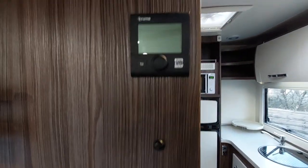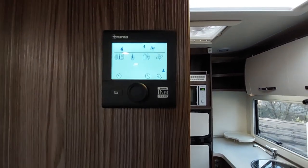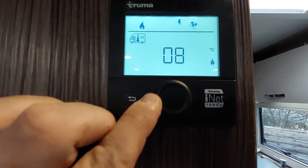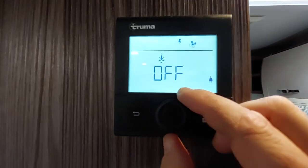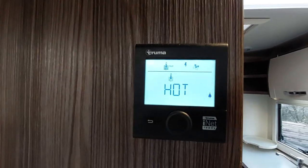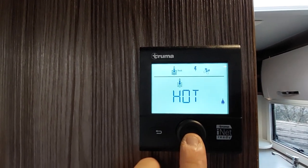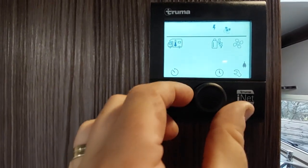Behind the forward-facing seats you'll see a thermostat just below and your heater controls above it. We always advise you try to do this when you either have gas in the vehicle already turned on or you are plugged into electric — it will stop any error codes. First option is your temperature: press the button, turn to the desired temperature, then press the middle button again. The next option is your water heater — you've got three options: off, eco which is around 40 degrees, or hot which is 60 degrees. There's also a boost option that takes all the power away from heating to get the hot water up to temperature as quickly as possible. If you're trying to get heating and hot water at the same time, press it on the hot option.